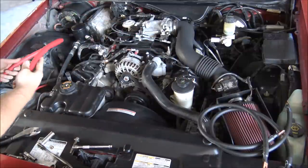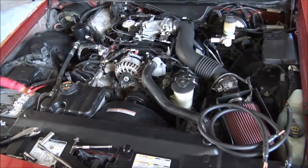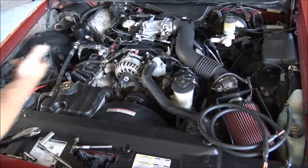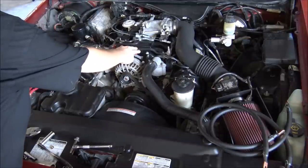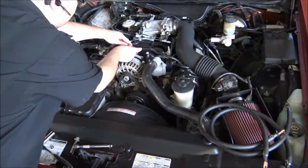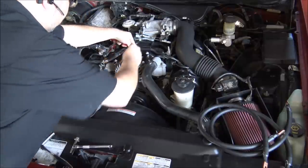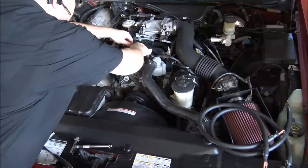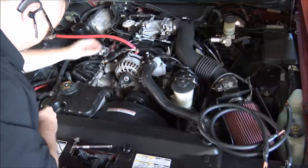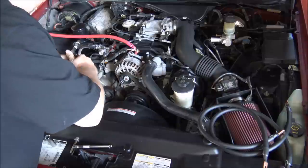One thing I always like to do is be sure that all the lettering is lined up on all your runs. Can you give me a hand real quick and just hold this end of the wire in the air? So the first run we're gonna do is your power run from your alternator power stud back to the power on your battery. We've done about an hour of prep work prior to making this video so that we can do a quick and easy view of the big three kit installation.